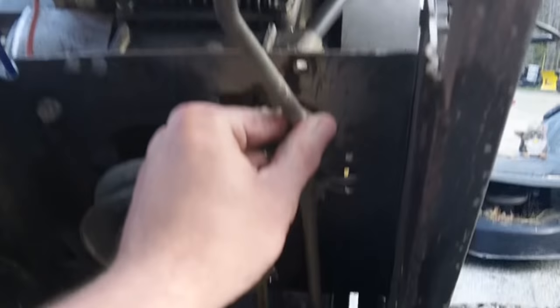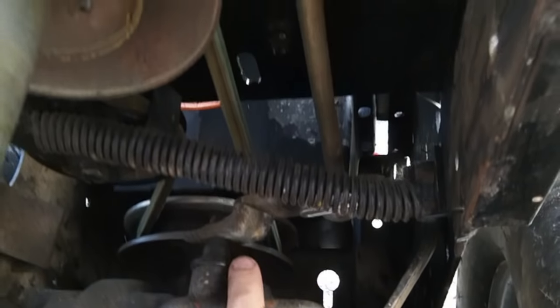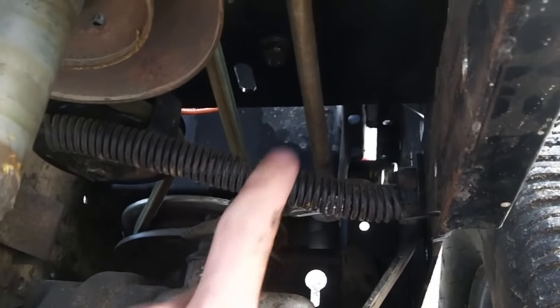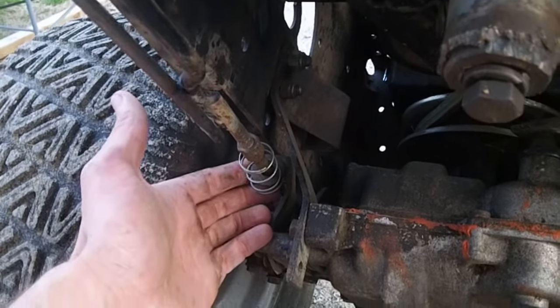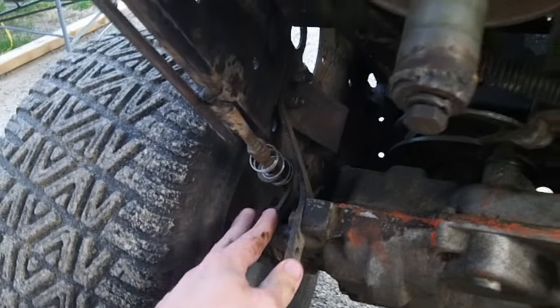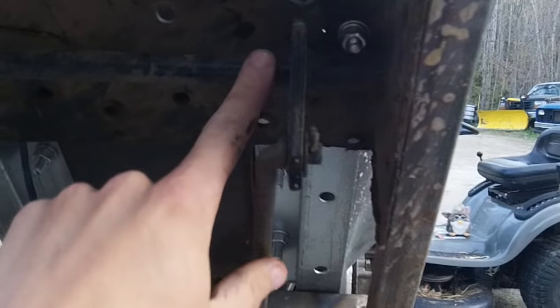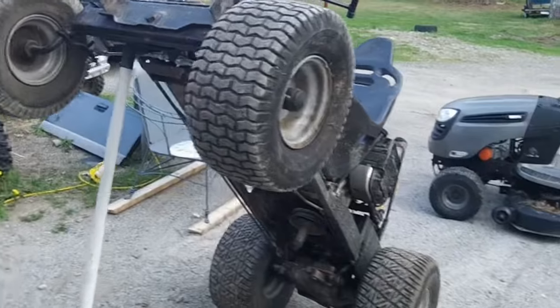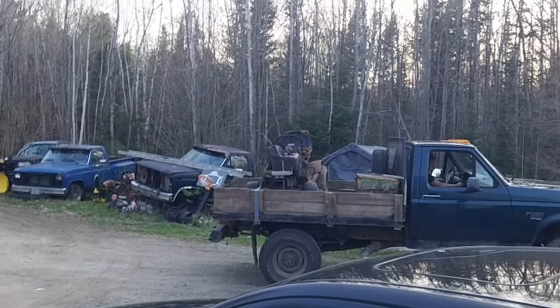As you can see, this is the shifting rod coming back, going to this linkage right here — and there's my custom shifter. What I found was that the original shifter came more out in this direction, and in order to do the press-back shift I had to put it over here. And here's my brake assembly — yet again just a regular LT-1000 brake assembly that has a rod welded to it, and it just presses back onto it like you normally would. This is actually the deck drop right here, and that goes to your shifter on the outside. Right now we've got something else actually showing up — I wonder what that possibly could be. Guess you guys better stay tuned to see what else is here.